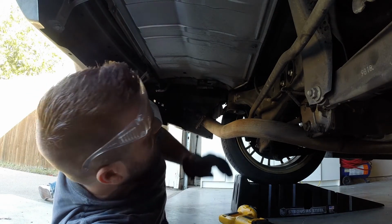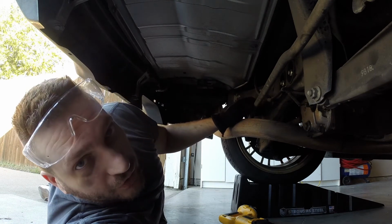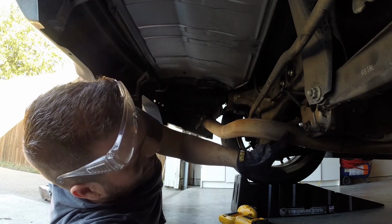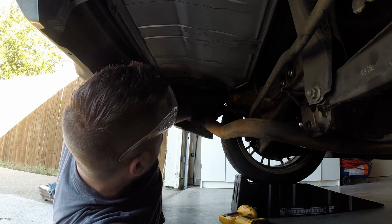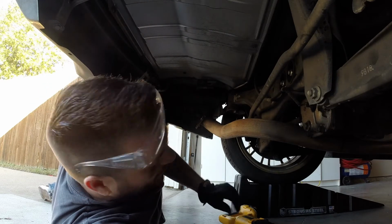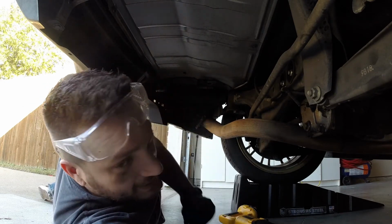It's been a couple days. I went ahead and pulled the muffler off, which fixed the issue of it not hitting full boost with the new tune. So what I'm going to do is go ahead and cut it right around here, because as it sits now, it's just blowing all that hot exhaust gas up here, and you can see it melted a little bit of the fender linings. Not too worried about those pieces. They're pretty cheap to buy new, but I don't want to continue to have that issue.